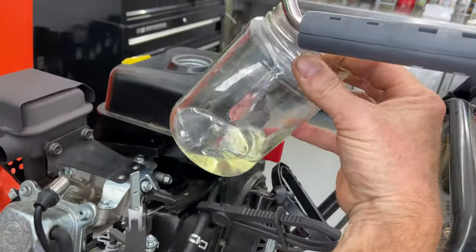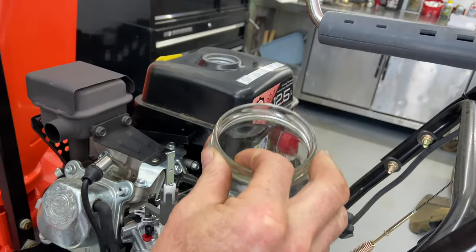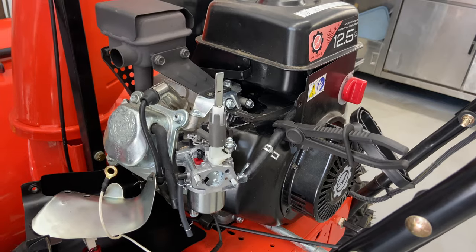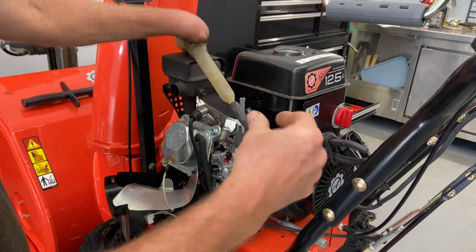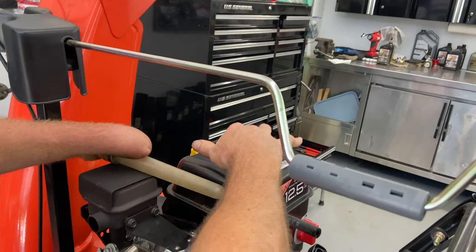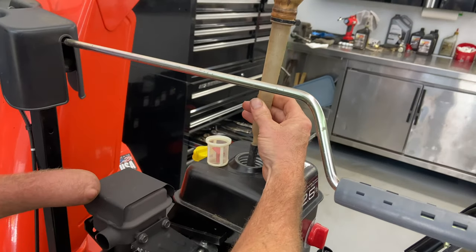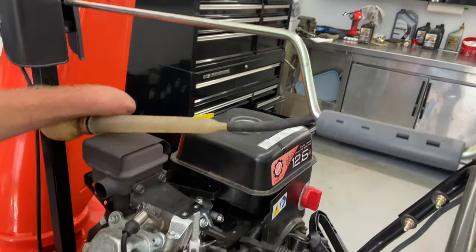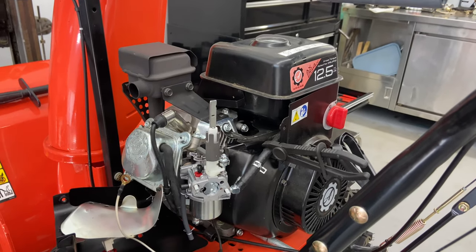This is the fresh stuff — big difference. It's a lot cleaner and clearer looking. When we attach that fuel line to the carburetor, it'll be good to go. This is a turkey baster I've used for many years — I put a little piece of fuel line on it. You can suck all the old gas out, get it down to the bottom, drain the rest out, then put fresh gas in and drain some through so you have fresh gas going to your brand-new carburetor.